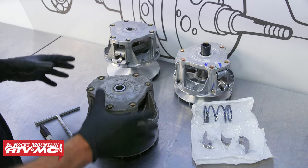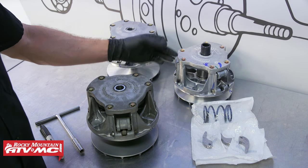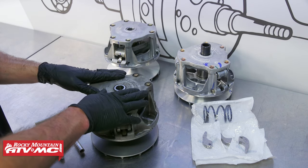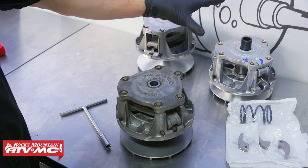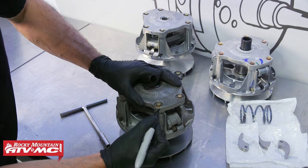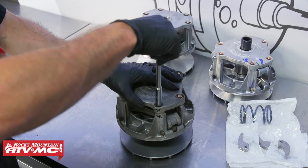The next steps will depend on which clutch you got for a replacement. If you got the OEM clutch, you're probably going to have to take a couple of extra steps — either reusing the old weights and spring if they're in good condition, or replacing them with new parts. At this point, we're going to pull the drive clutch cover off. If you're going to use an OEM replacement, you want to index the cover to the tower, so we'll make an X on both of them. Then loosen all of the bolts about a quarter of a turn. We have a special clutch press tool — here we have the SLP clutch press — to help remove this cover.